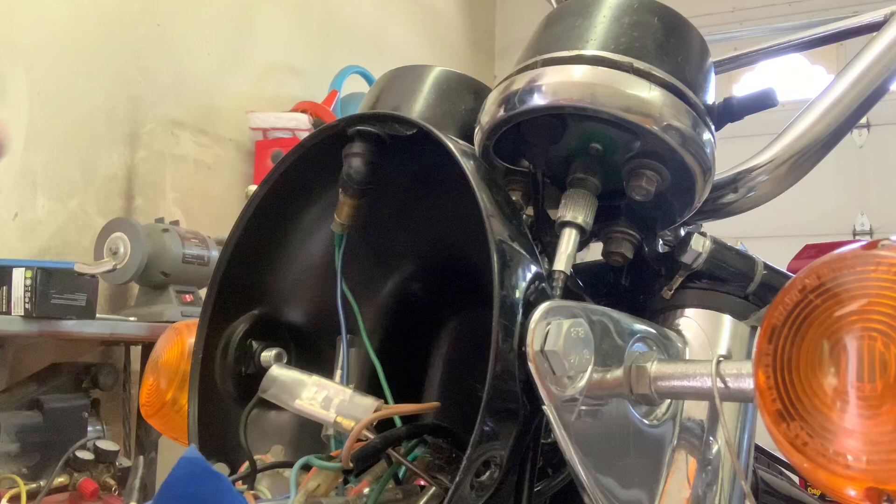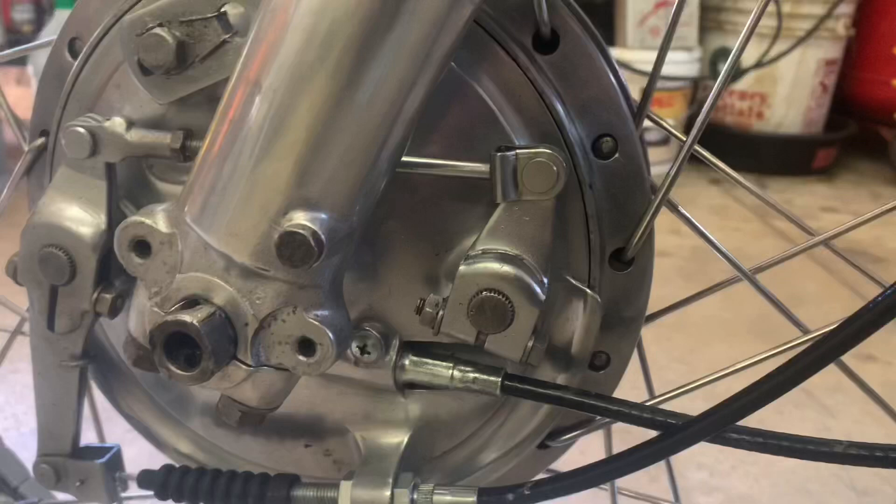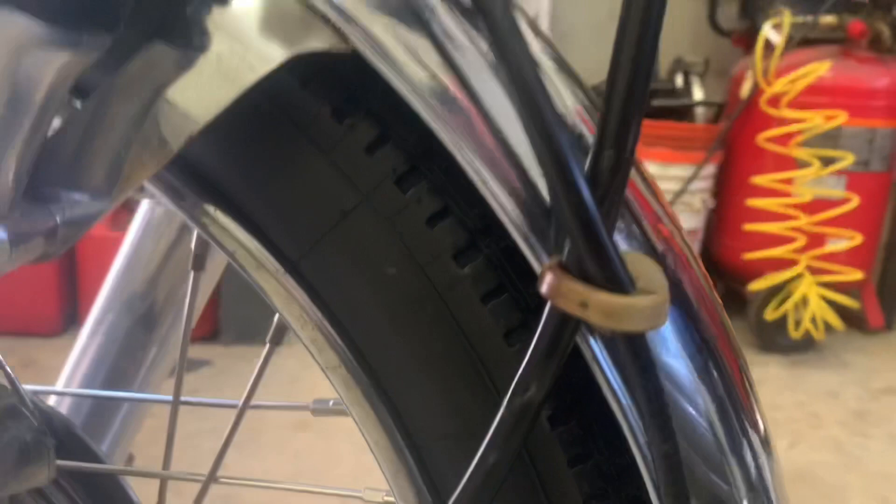Let's take one last look at what we did. I think the biggest thing to remember is use the anti-seize on that screw. Move it up through your connector there. These both are nice and loose in here — that thing is holding just fine. Move it up towards the front of the triple tree, come up through the front. There are no metal clasps on this one holding it into position on a '70 or an older one — sometimes there's a little tab on your ear to be able to do that. Then right up straight, don't nick any wiring, and go ahead and put that into your speedo cable.